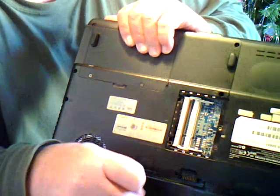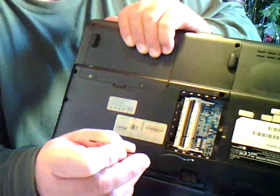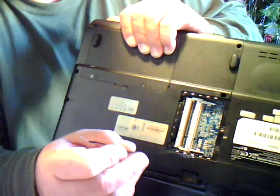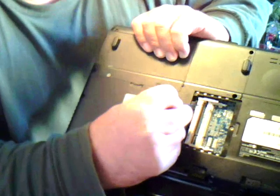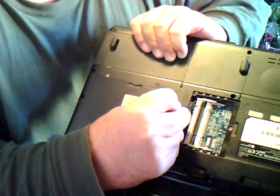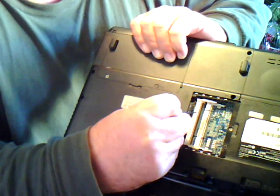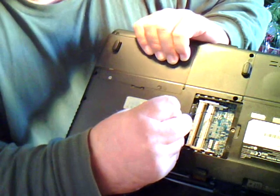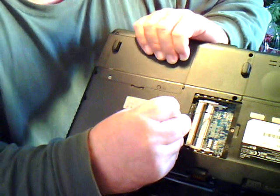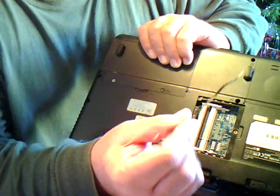It is two tiny gold squiggles printed on the motherboard. There is a ground located right here at the solder joint where the memory slot is soldered to the motherboard. That's a ground. Right next to the ground, right here, is the small square containing the gold print labeled J1. I use a bread tie because it's very convenient and it works very well.